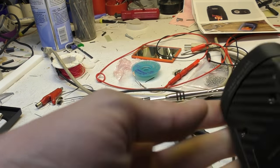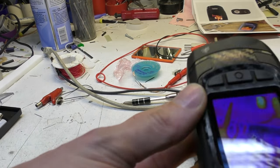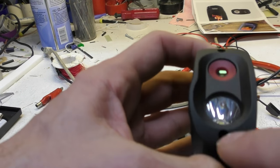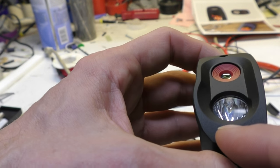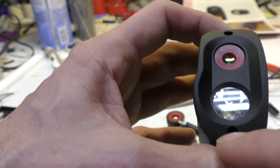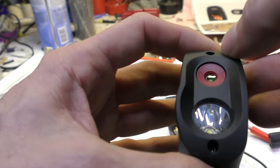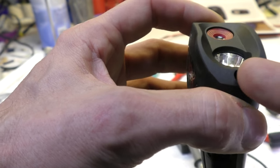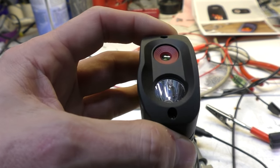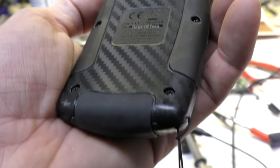Overall the initial feel is quite nice — good build quality. Now it's time to see what's inside. The front screws are five-sided security screws, similar to an Allen key with five sides and a security pin — a bit overkill, but the pin is small enough to snap out with a flat driver and then use a standard pentalobe driver. The rear screws look like fairly conventional Torx.